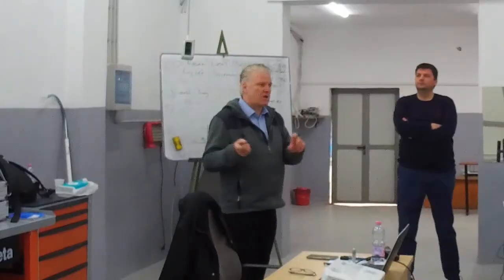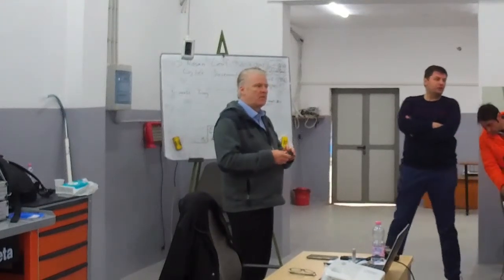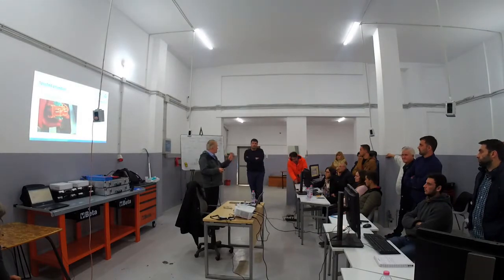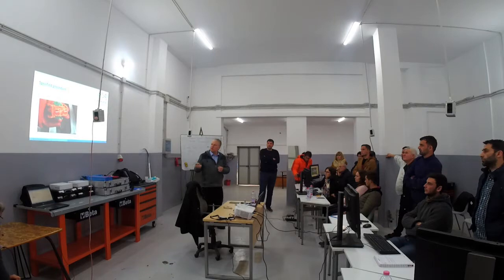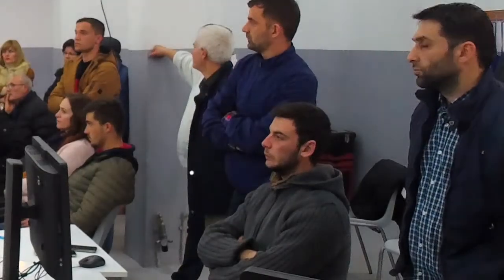In other cars we have only a switch to move. In other cars we do not have a plug, but we have a switch that we move. So it depends on the car, especially when we're talking about the Nissan Leaf. We have this kind of disconnection plug. And this depends on the car being worked on. In this case, the Nissan Leaf has a special disconnection plug.